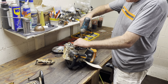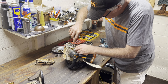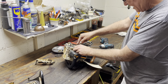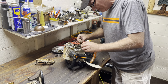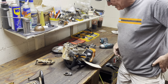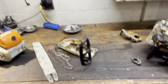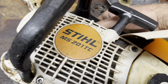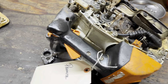Slide the old pump off here. I don't know how it ran up to this point — maybe the bearing just disintegrated. When you look at the wear and tear on this saw, I can't honestly say I'm in the business of fixing things. We've replaced the muffler on it. I'm sure I've done a top handle swap on this at some point. Starter housing's pretty rough. It might be a good parts saw, but let's dig in a little deeper.